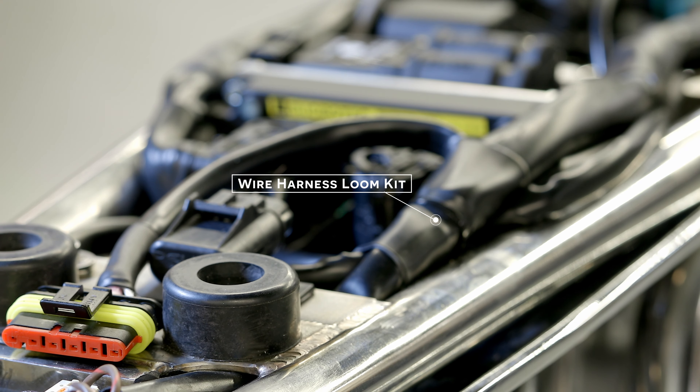Moving forward we've got the coils required to run the motorcycle, and then continuing farther forward we have one of our tiny horns. It fits inside the frame triangle, still puts out 100 decibels, only draws one and a half amps — small, gets the job done.